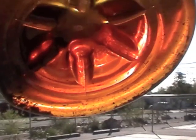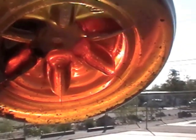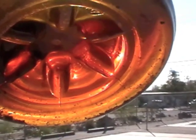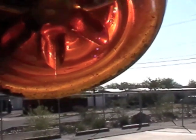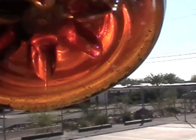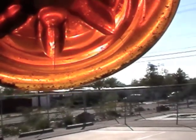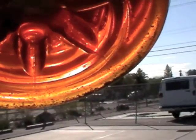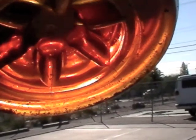And I believe those chunks are what causes the plugging of fuel filters in people who first get started on biodiesel. It's not that biodiesel is such a good solvent that it cleans out the fuel tank. The problem is that when people start with biodiesel, they have some diesel fuel in their fuel tank, and that diesel fuel causes precipitates to precipitate out of the biodiesel.